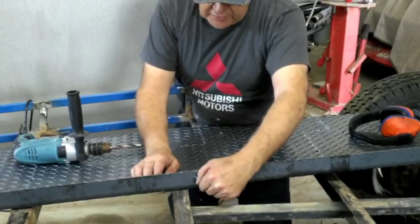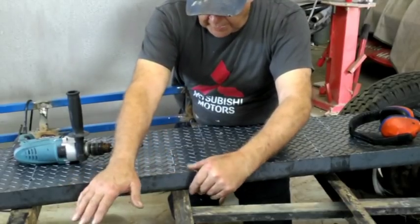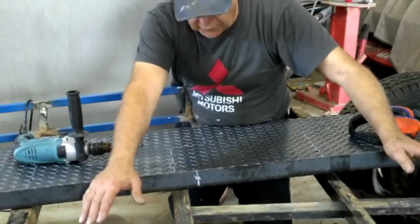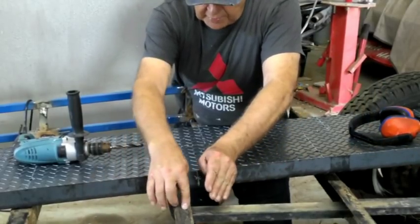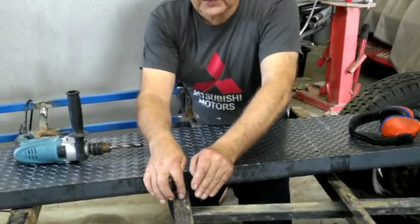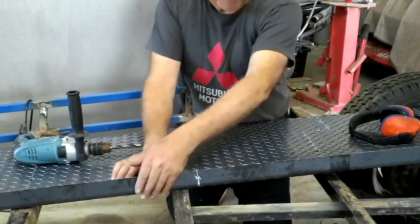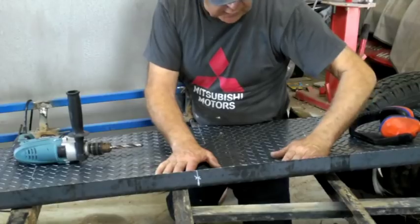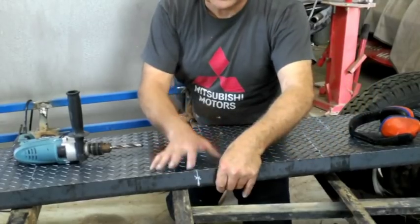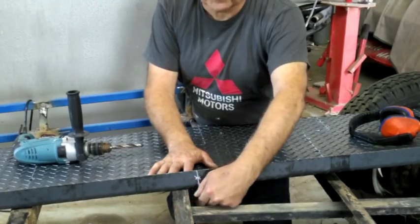This is where I cut the chassis of the caravan to drop its tail. I'm using two sheets of flooring per side, and rather than bringing them together here and making a joint, to get the greatest strength I've deliberately taken the first sheet and overlapped it right across this joint. I'll cut the angle and bend the sheet — that'll give me the greatest strength over where I've cut that chassis and re-welded it.